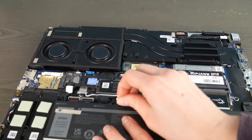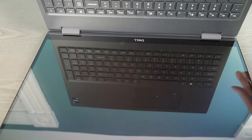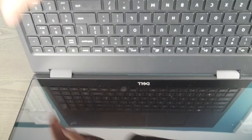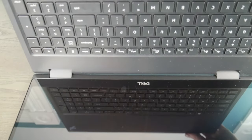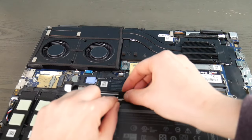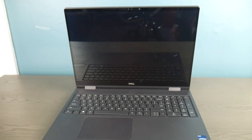Unplug or take out your battery like so. With the battery unplugged and the computer unplugged from the power cord, I held down the power button for a whole minute to release all that residual power buildup. A lot of shops will actually charge you money for this — they call it a hard reset. So you might have paid good money for this really easy procedure. Then go ahead and plug the battery back in — this was my first step in the troubleshooting process — and try the power button again.